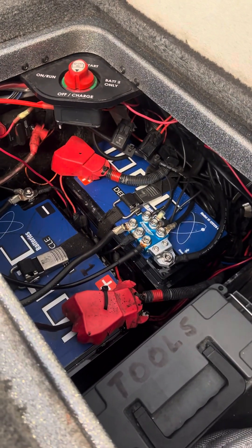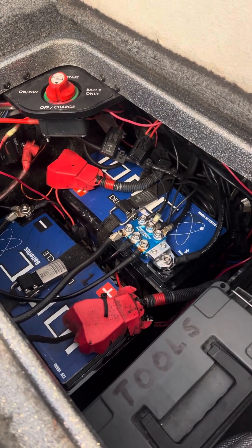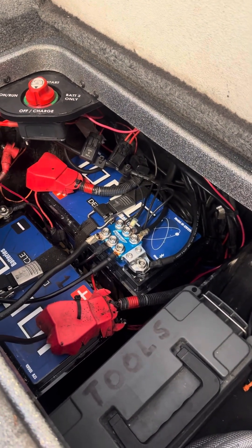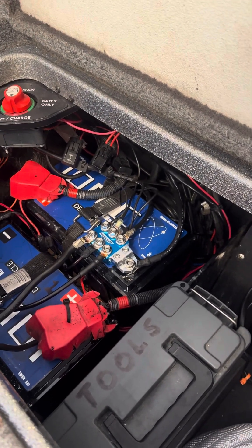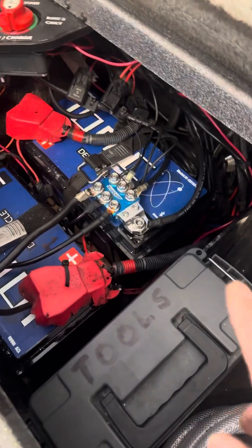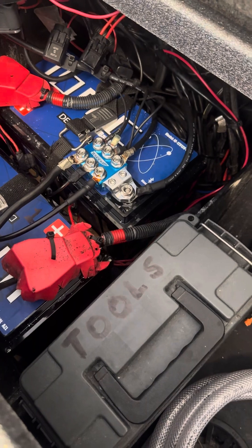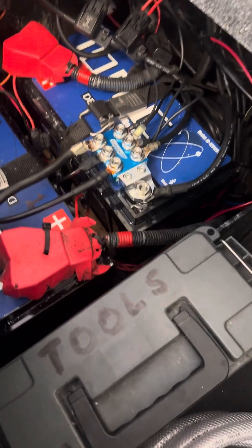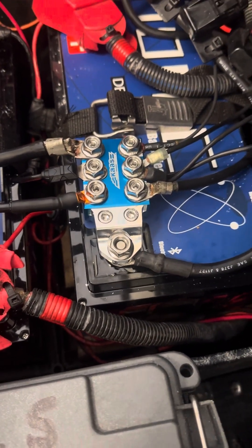I've got some aftermarket accessories: a light up on the power poles, an LED package in the boat, and a bow mount trolling motor white LED light I use for nighttime running — coming into ramps, canals, and looking for markers. But there was not enough real estate on the negative post on the Ionix for all the negative grounding I needed, so on Amazon I found a nice set of electrical bus blocks. That gives a clean look and I was able to run all the power there.